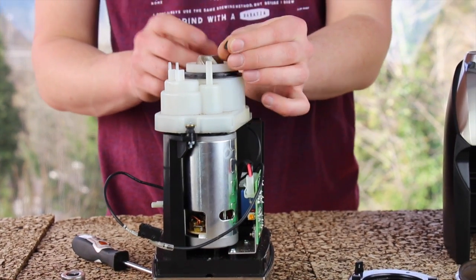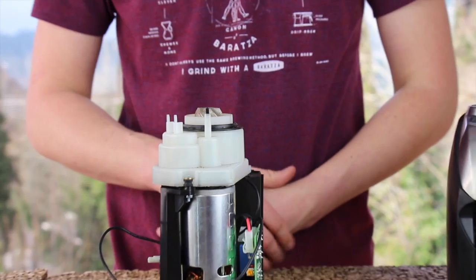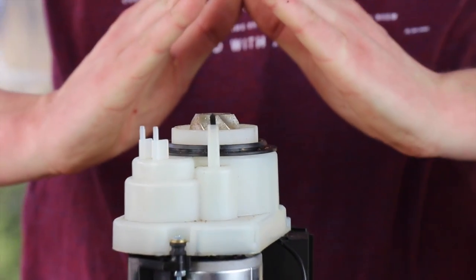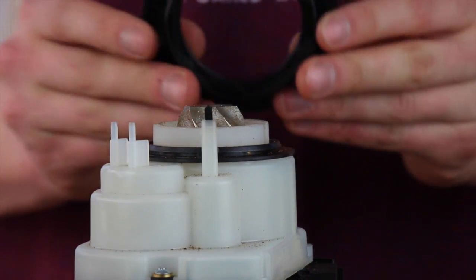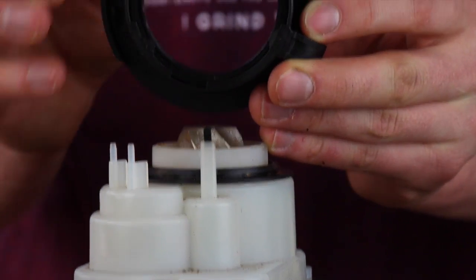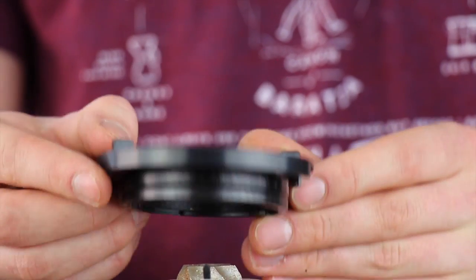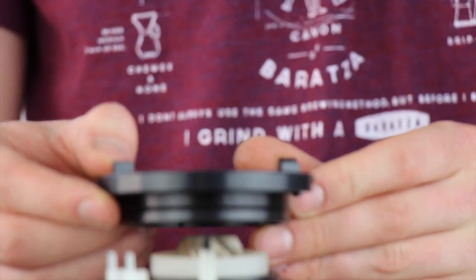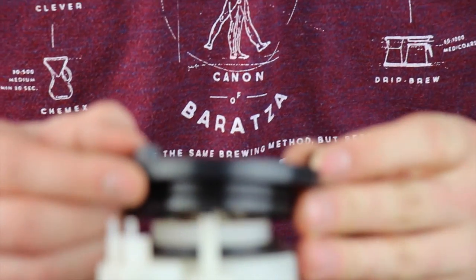Grab your tiny spring-loaded detent that provides a clicking noise and set it in the column on the gearbox with the pointed side of the detent facing up. The bottom of your adjustment ring has serrations 180 degrees around it. Any point of these serrations over the detent will install well. Go ahead and put your adjustment ring on.